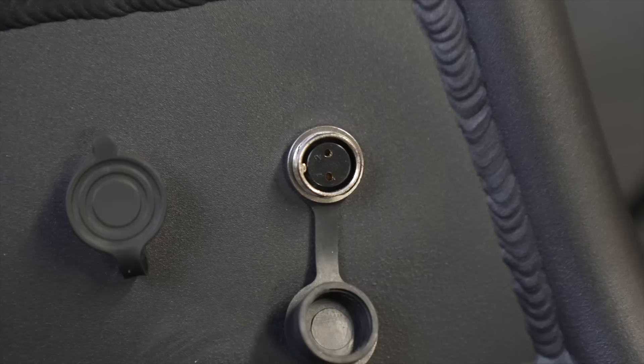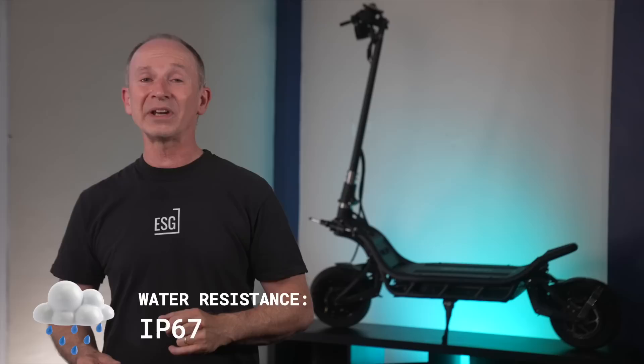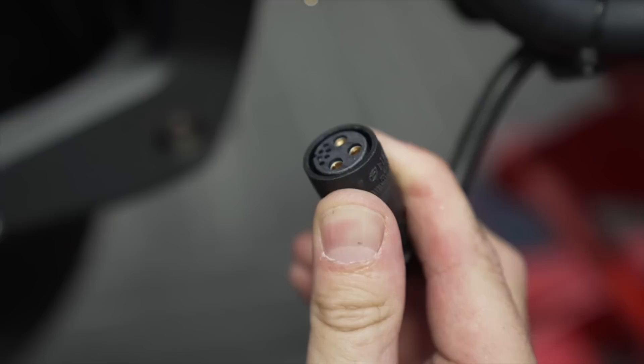The back of the ports also has improved protection from water. Fender protection is excellent, and the scooter is rated IP55, with controllers, dash, and quick disconnects rated at IP67. The motor cable now has a quick disconnect, which comes in handy for tire changes, but you'll need to warm it up with a hair dryer to get it unplugged. The 11-inch tires are tubeless and look just like the flat-proof CST brand tires on the King GT, but they're the regular CSTs without the coating inside.